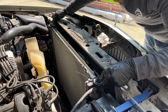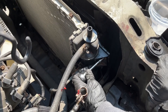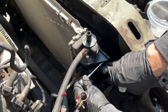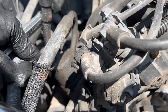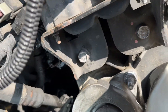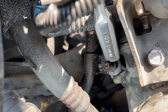There are two bolts that hold the top of the radiator — both 8 millimeter, one on each side — and we're going to pull those off. There are also two bolts that hold the condenser onto the radiator, 8 millimeter, one on each side. To get the high pressure line off, which also has the accumulator on it, there's a nut underneath — 13 millimeter, and you'll probably need a deep-well socket for that.